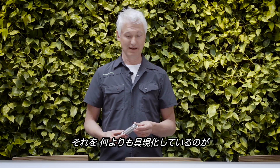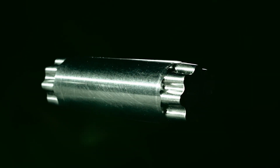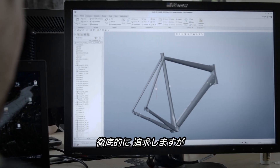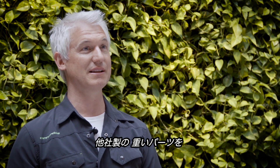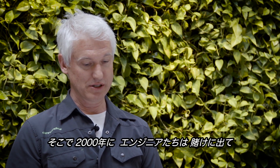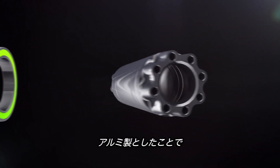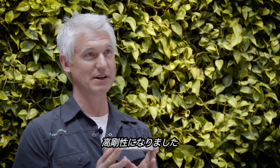There's probably no better example of that than this piece right here: BB30. Every year our engineers were killing themselves to make lighter and lighter frames, and it would drive them crazy to make these small gains in the weight of the frame but then have to hang these relatively heavy old parts on it. So back in 2000 our engineers took a leap of faith and said there's a way that we can make a better crank and bottom bracket — by oversizing the spindle and making it out of aluminum. You end up with a lighter, stiffer package.